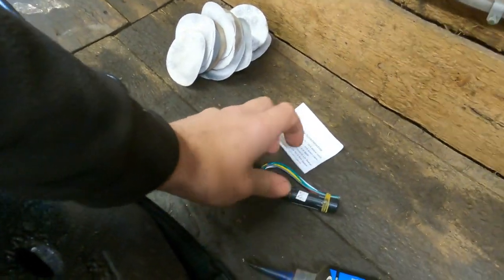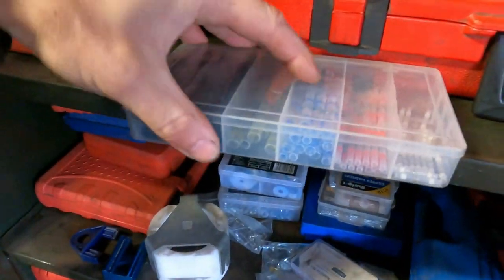Yeah, so there's the new bit. I'll probably just do that off camera, like I say. No one's going to want to watch that. I'll just solder the wires and heat shrink it. I've actually got these, you may have seen them. I'll just show you. I'm explaining stuff, but it's basically a solder and heat shrink. You just join the wires up and then heat it with a lighter or a heat gun. It melts the solder for you and then shrinks the insulation around it at the same time.